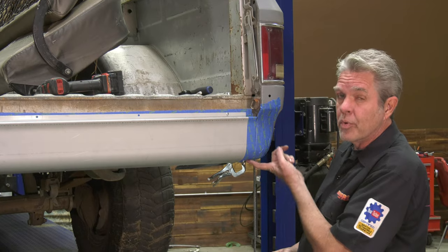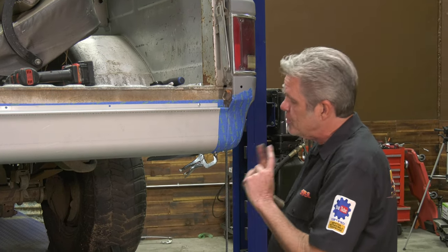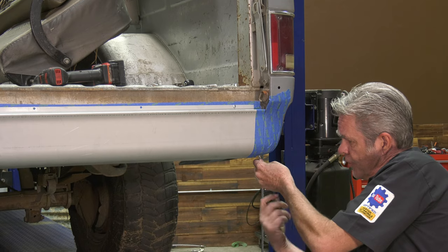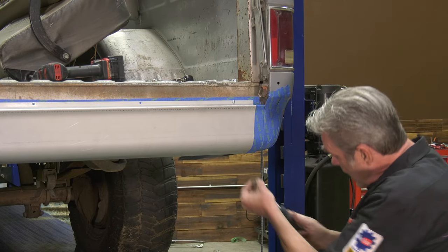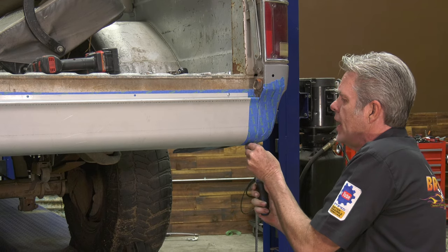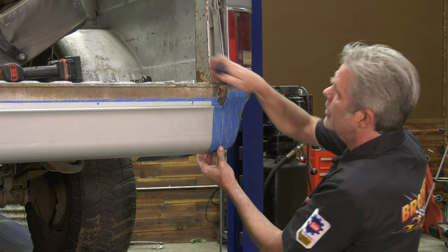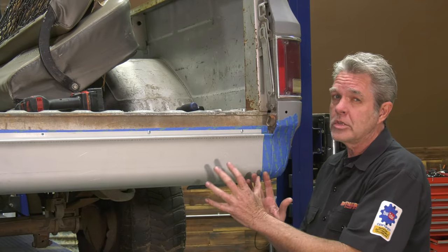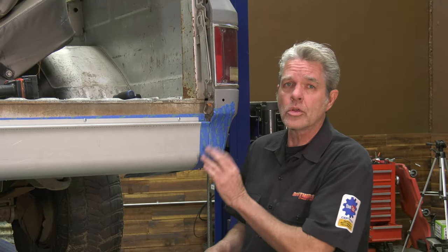Now I've got to drill the little hole for the brace in the bottom, and since the brace is on top it's difficult to get the drill bit in exactly the right spot. So what we're going to do is simply take this clamp off, unscrew the little bracket from the inside, and put it on the outside just like this. Now I'm going to be able to line up my hole perfectly and drill it out, so when I flip this up on top my holes will line up and won't get out of position. By doing your trial fit before you painted, everything's going to fit perfectly. I'll take it apart, prep it all up, paint it, and put it on exactly the same way — putting tape back on to make sure nothing gets scratched.